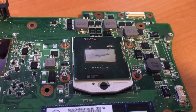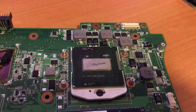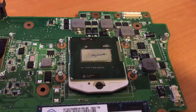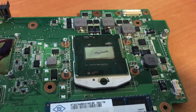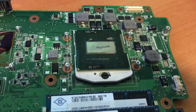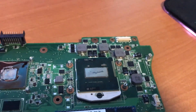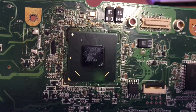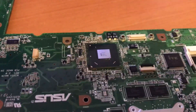The M means that your processor is socketed. Socketed means it can be taken out. If you have a U or most newer processors, they won't be upgradable. The first three or four generations of mobile processors were upgradable. So if you have an M in your processor name, it's socketed — but that doesn't already mean you can upgrade it, because your motherboard also has something called a chipset. Mine is an HM65.